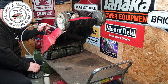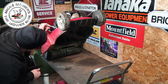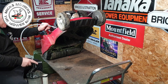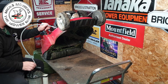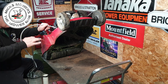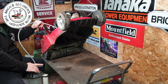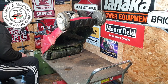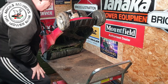It says here for cleaning tips please refer to the owner's manual. There's a lot of grass underneath here that needs to come out. If you're interested in where to get one of these extraction pumps, there's a link in my comments section and on my about page. You can tip a lawnmower on its side — always carburetor side up — and make sure the machine's not hot when you do it. That's all the oil extracted now. This is a 2014 model. I'll remove the HT lead now — it's got an NGK spark plug in there.